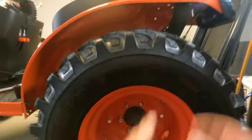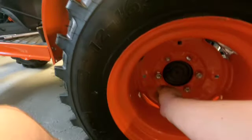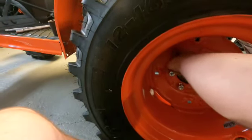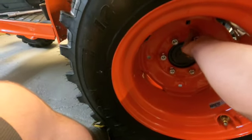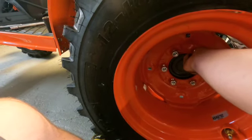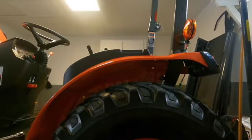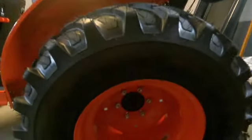The studs don't come installed on the back — they do in the front. So I installed them, put some loctite underneath, and I'm never going to take them out again — at least I hope not. I'm just going to zap these on with the small impact and then torque them properly when I'm all done.